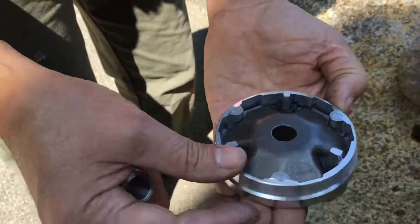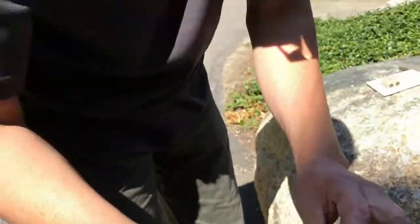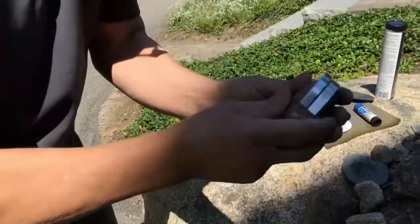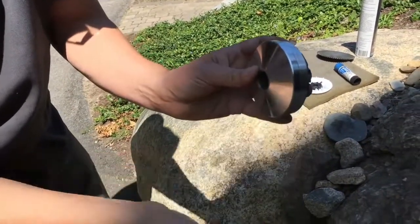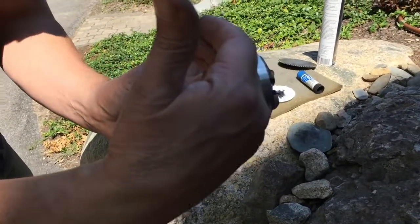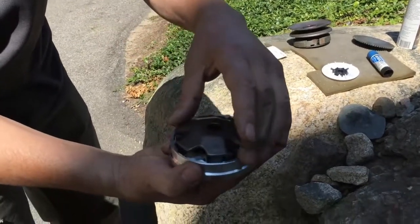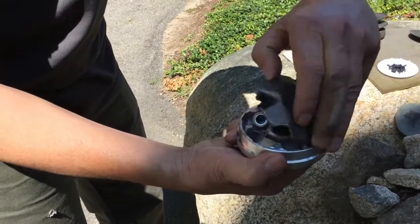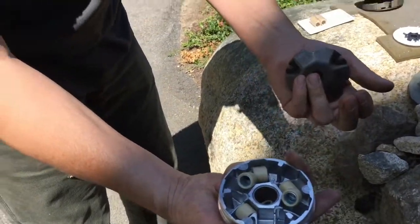The main problem people make is when they change this, their belt has already broken. If you shake this, with your variator boss in it will be very fat like this, and they'll just go and try to put a belt on there — you cannot do that. Because what you have once your belt's broken is this big mess inside, and it's just going to instantly burn up your belt.